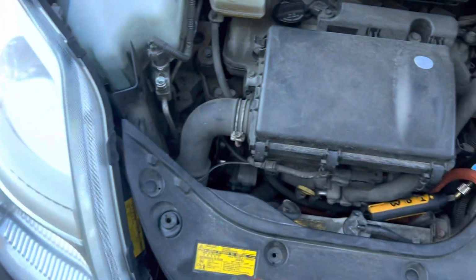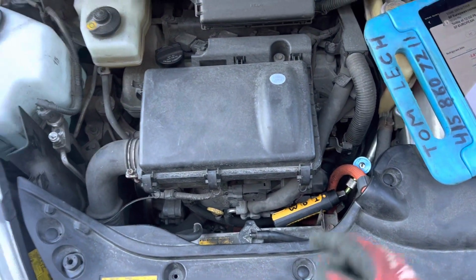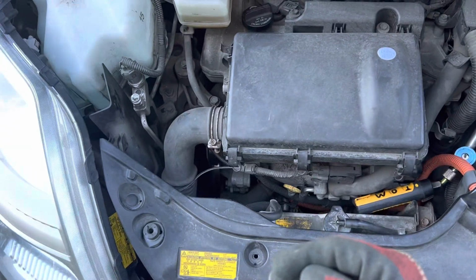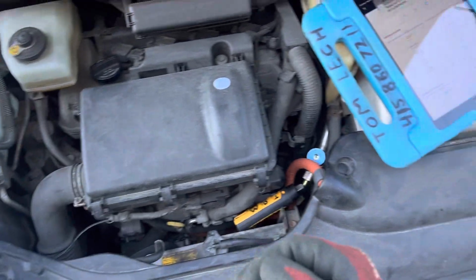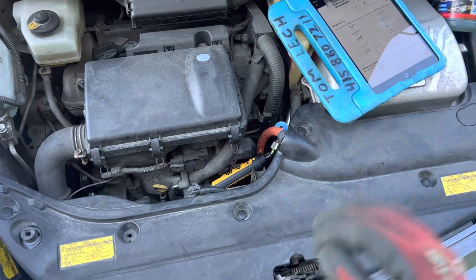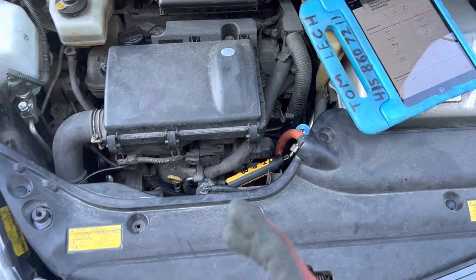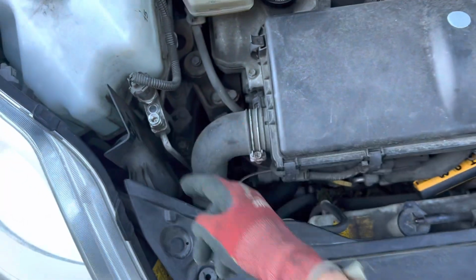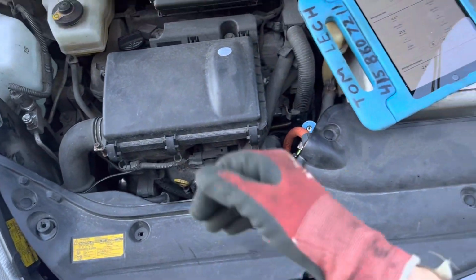If I'm at negative 2 vacuum over here, then that's like somebody did take out the refrigerant and didn't put it back in. We'll find out. There's always a story. It's like being a detective, and you have to put all the pieces of the clue together to find out why. But not a very happy compressor, judging by that black sight glass. I'll be back. See you guys.